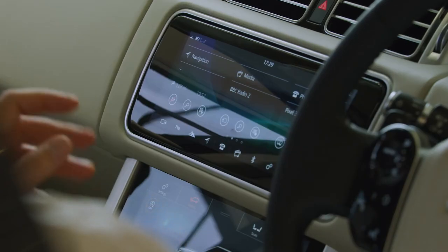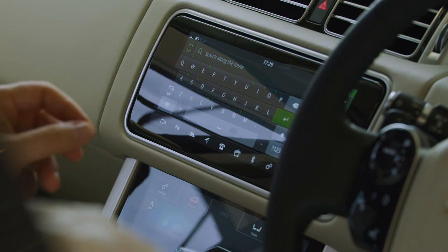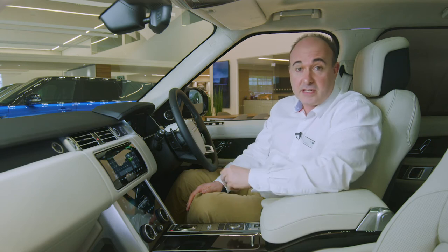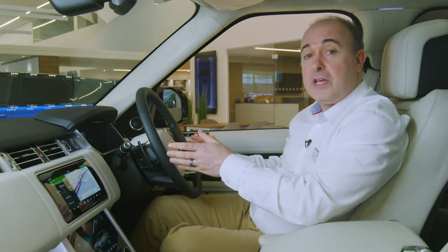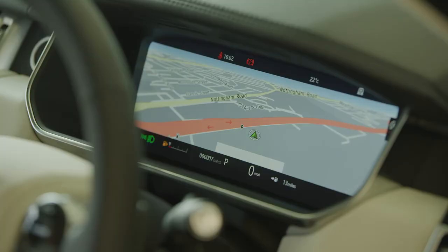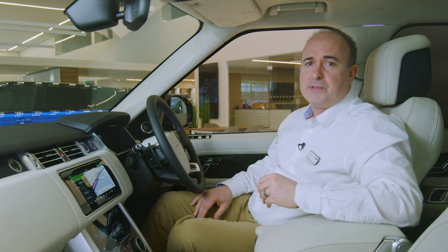The third option from the home screen is the navigation system. To input a new destination, tap on the magnifying glass and then type any postcode, address or point of interest into the search box at the top of the screen. You can also search for businesses and transport links, hotels and restaurants. Where possible, the system will show TripAdvisor reviews. Destinations can be easily set by voice. As well as appearing on the main 10-inch screen, navigation instructions will also be shown on the cluster display in front of the driver. The display can be reconfigured for a one or two dial display by pressing menu and selecting display options. You can even bring the map across the whole screen, retaining a digital readout of your speed. Range Rover is supplied with a 4G data connection to allow over-the-air updates of the infotainment systems and maps, and provide live traffic, flight information and internet search. When the system has an update available, it will alert the driver on the main menu screen and ask for permission to update when you switch off the engine. Only agree at a convenient time, as the car must then remain switched off and locked for up to 30 minutes whilst the update is applied.